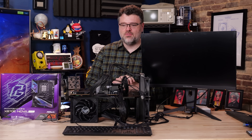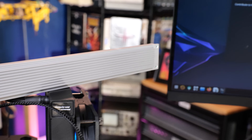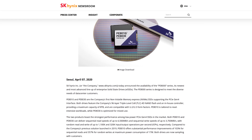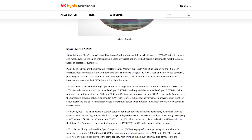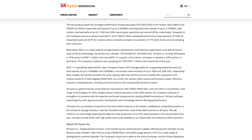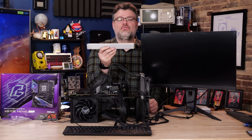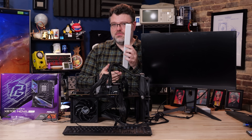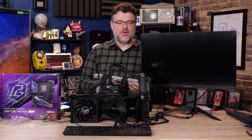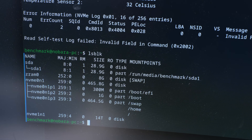I also talked about 16 terabytes of storage and how we're going to enable that. This is an enterprise storage drive — it looks like an isolinear rod, but larger. This is 16 terabytes of flash that cost many thousands of dollars not all that long ago. It was designed and specified by the Open Compute Project. Servers that have this for storage are coming off lease, and so occasionally through local government surplus or university surplus, you'll see them pop up. It's worth about $500 on the market — you shouldn't pay more than that, because there are some downsides. It's PCIe Gen 3, doing about four gigabytes per second read and write, and it has a PCIe Gen 3 interface.